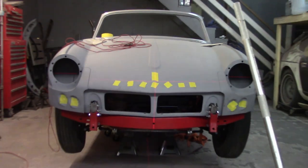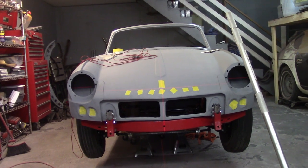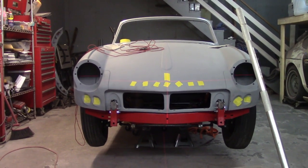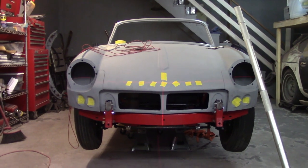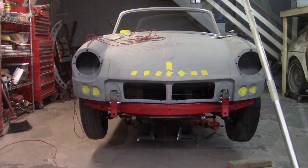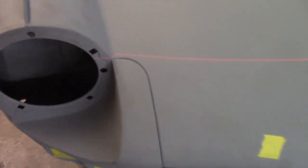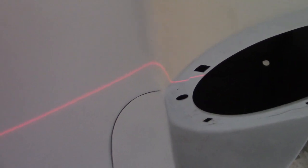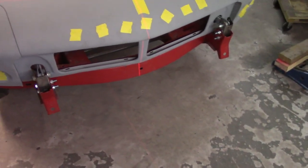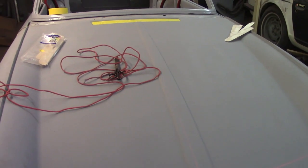Now I've got the frame pretty much level - the back seems to be nearly perfect, the front close enough. I want to find a reference point on the bonnet and see how level the bonnet is. I'm not incredibly concerned with the levelness of the bonnet because the bonnet's the easiest to move. Where the laser line is, it essentially meets that seam on one side, but on the other side it's quite a bit off, so the bonnet is not level to the frame - this side would need to come up or the other side go down.